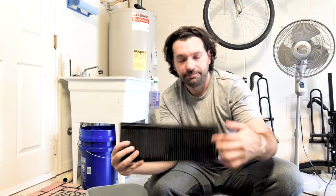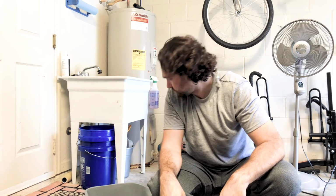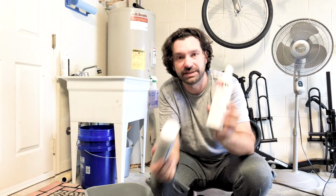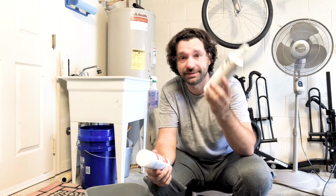So we have those little dark spots. So what we're gonna do is degrease them. If you buy the K&N filter charger kit, it will come with the degreaser, as well as the oil that will impregnate the material again. So let's see if we have some. I did find some. So if you don't have this, I've done degreaser before as well, works just great, but because we have it, we'll use it.